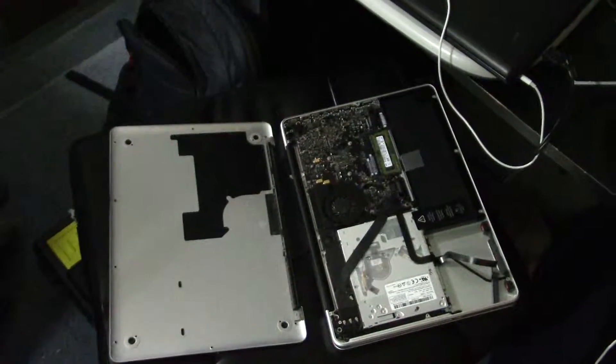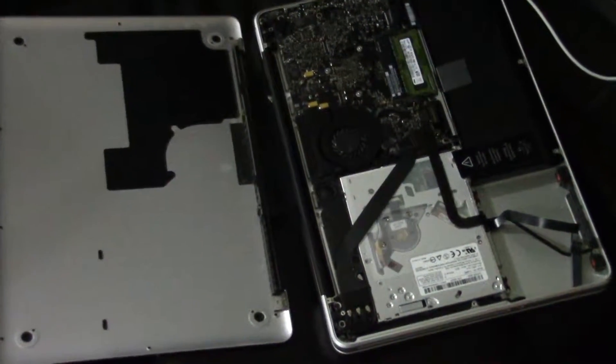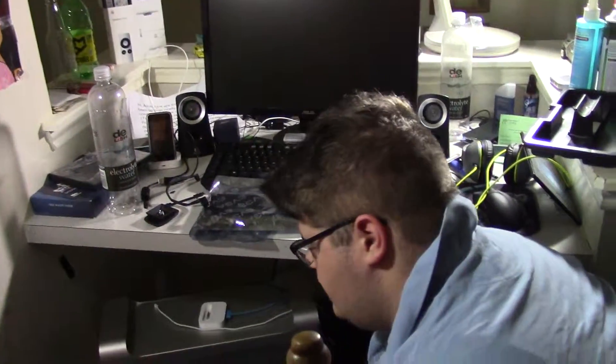Hey YouTube, it's me Bruno98. We're having some issues here — as you can see I'm kneeling in front of the Mac Pro, but the Mac Pro is not the thing with the issue, it's the MacBook Pro. It's refusing to boot off the drive, and when it was running, the drive had reached near max capacity thanks to Boot Camp crashing during partitioning. So I'm having to put the SSD into the Mac Pro to install OS X onto it, since the MacBook Pro won't recognize any USB bootable drives. We're trying to install El Capitan onto the SSD, but the installer won't recognize the PC graphics card, so I've got to reinstall the 8800 GT just to do this. Let's get started — this is so frustrating.